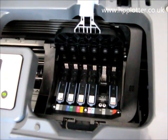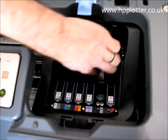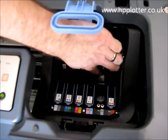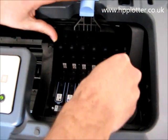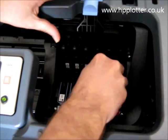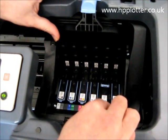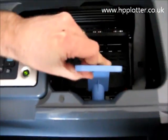Get in your replacement one. Double check that the DesignJet hasn't got too much ink contamination — if it has, just get a lint-free cloth to clean that up. This one is perfectly clean. So we've got a new print head; plug it into the machine. That beep shows it's being recognised.